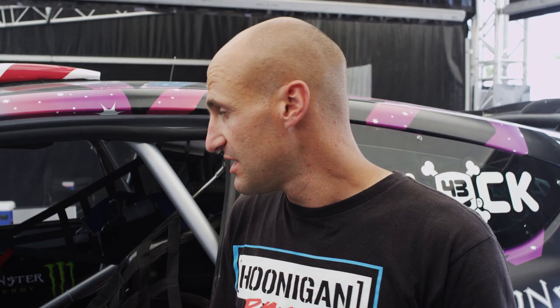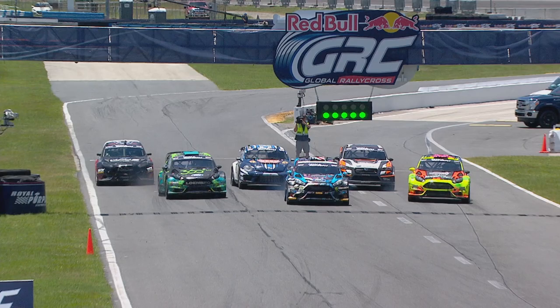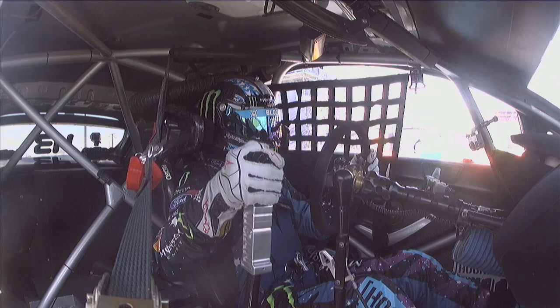If he feels that there's not much grip at all and it's likely that when he drops the clutch he'll just wheel spin, you can actually change the rev limit, make it lower, so that when he actually drops the clutch he can get as much power as possible onto that first straight.